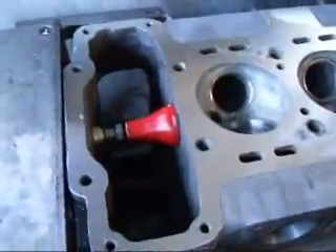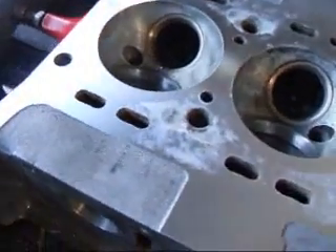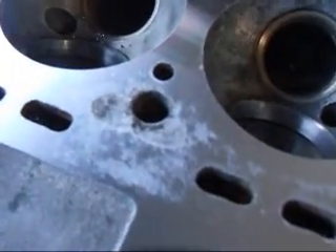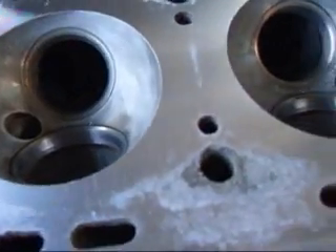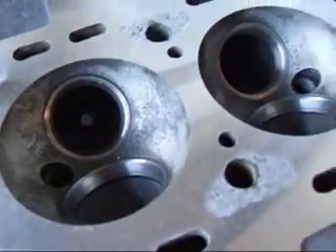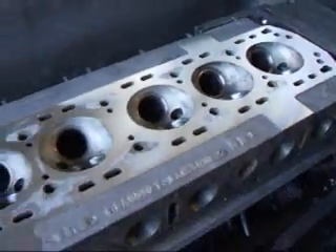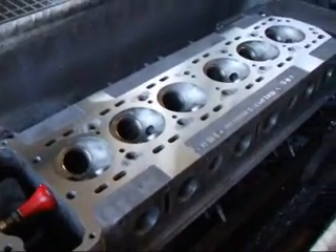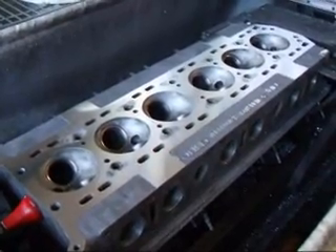So let's take a look at what we got. As you can see this thing's cleaned up pretty well, but we do have some small areas where we do have corrosion damage and we're going to have to get rid of a little bit more of that for the gasket to seal properly. So far I've taken about five thousandths off this head to get it back to where it's level again, and we're going to go ahead and start the machine and take a little bit more.